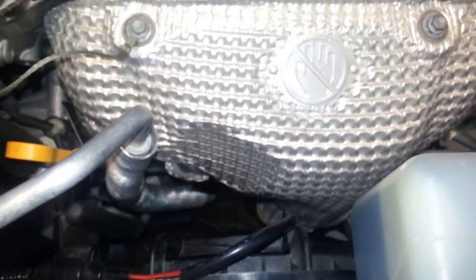Just wanted to show these exhaust manifold heat shield bolts here. Just thread them in loose. That bottom one, my hands were small enough to squeeze in there, but probably if you come in on the right hand side and put your hand down here. The bolt right there where my finger is, you can thread it in and use a wrench from up top. Probably easier. Of course, I applied some anti-seize compound to them. And you don't need to go full gorilla on these. I would torque them down to maybe 8 foot-pounds, 10 at the most.